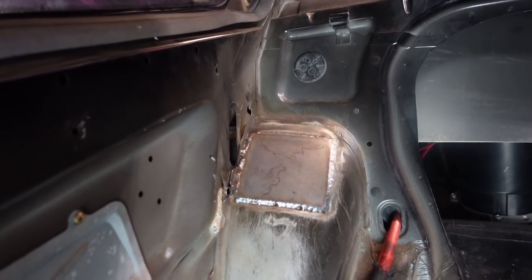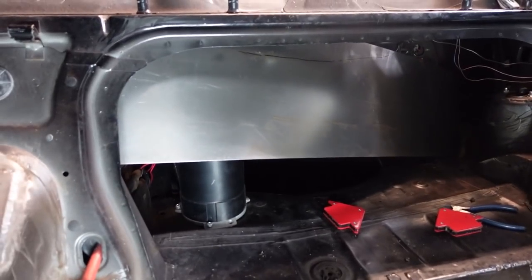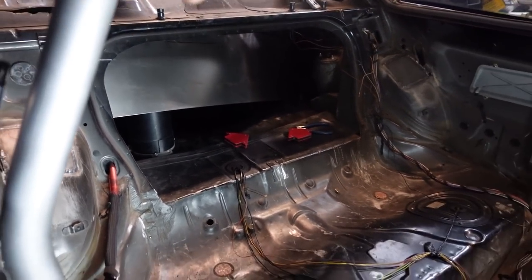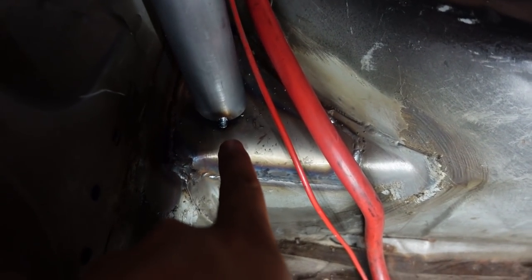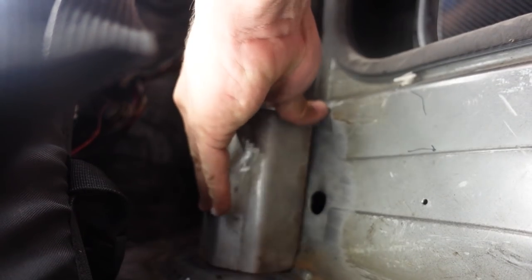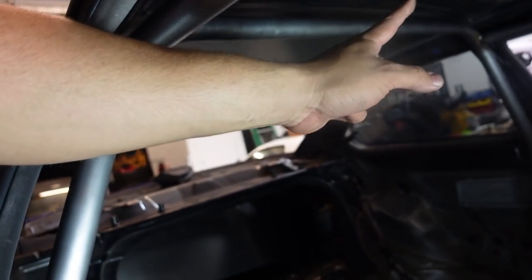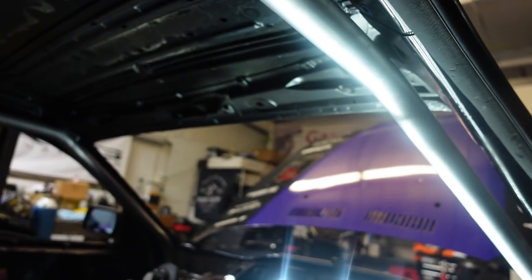I just took care of the rear plates — these ones are going to be on the wheel wells. I'm not going to mount on the chassis back there because I'm going to put in the reinforcement bar allowed by FD rules, so this is a nice easy way to put the bars here. That way I can have a one-piece firewall and a lot more room back here. I welded the A-pillars halfway through — like a half circle — then I'm going to grind this tack weld, pull the roll cage forward, and it's going to drop about four inches down in the front, allowing me to weld the top. Tomorrow we're going to drop the cage, weld the top, weld the down bars, and fabricate a halo tube with bends on both sides to tuck it up as high as possible to the ceiling.